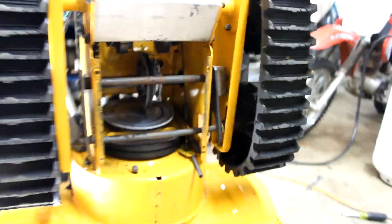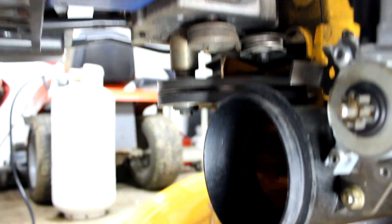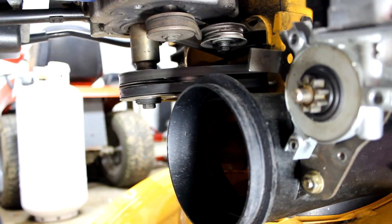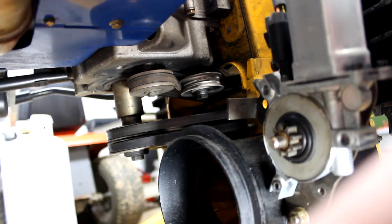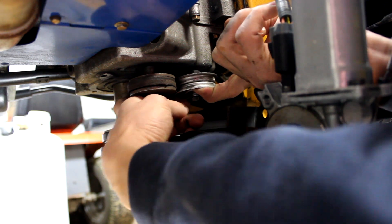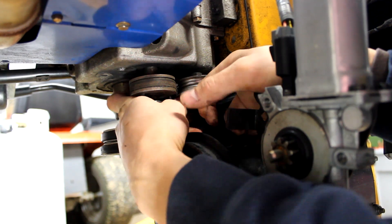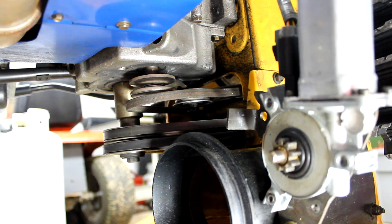To replace the drive belt, you're going to come on this side of the machine. It's similar to the other side — you have an idler wheel, or a pulley. We just need to roll the belt off of that, similar to how we did the other side. You basically just need to pull the idler wheel and roll the belt. And there we go — it's loose now. So we'll go to the back again and work on it from there.